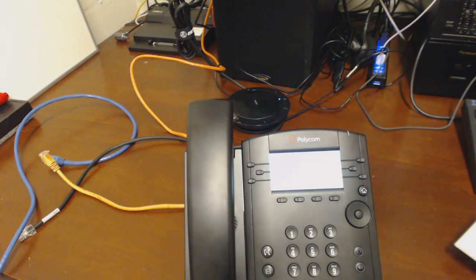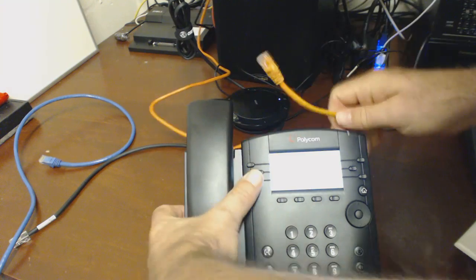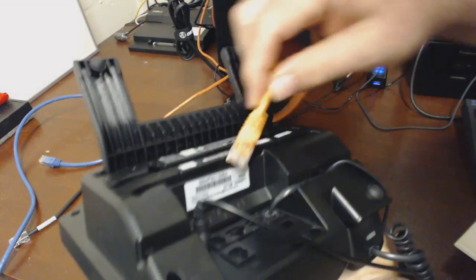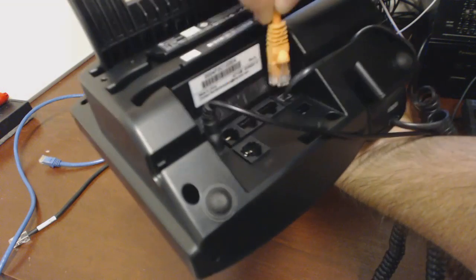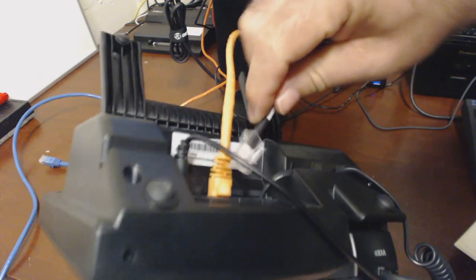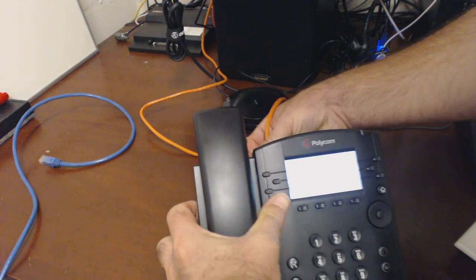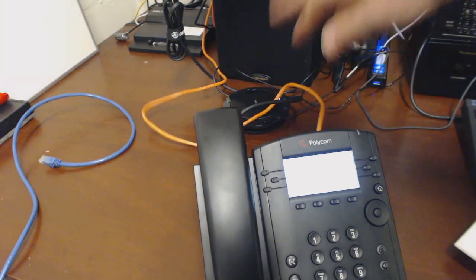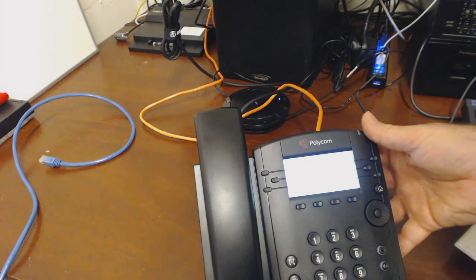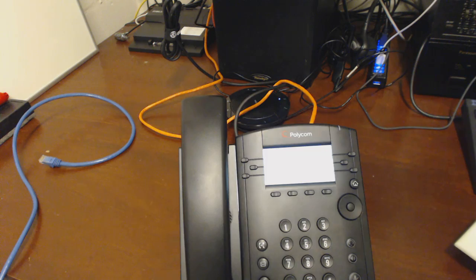So that's usually indicative of either one of two things. Either one, the network is not plugged in, either it's not plugged into the wall or it's not in the right socket, or like I said in the back, it's not in the right spot. Or the other thing it can mean is that there's a network problem further up the line. So, and that's nothing really you can do much about. But if you know your physical connections, the wires going back to the wall and going to the PC are correct, but you're still seeing network down or an exclamation point, it might mean a few things.